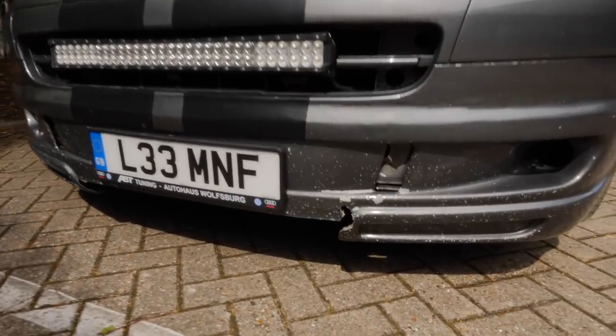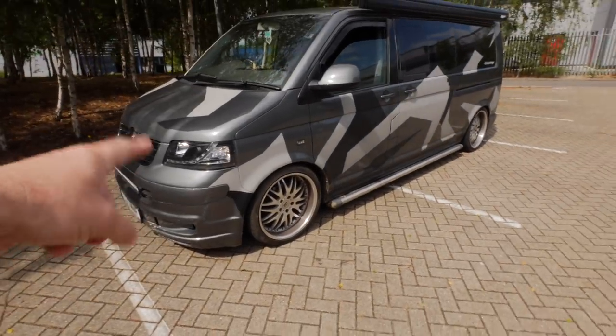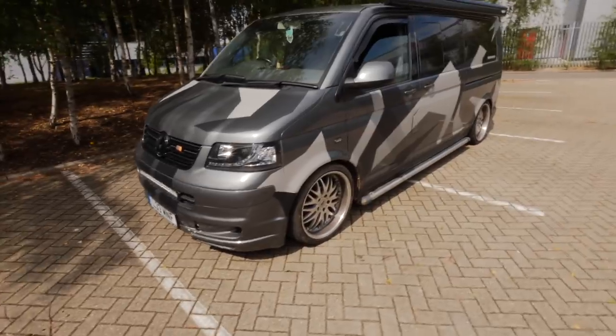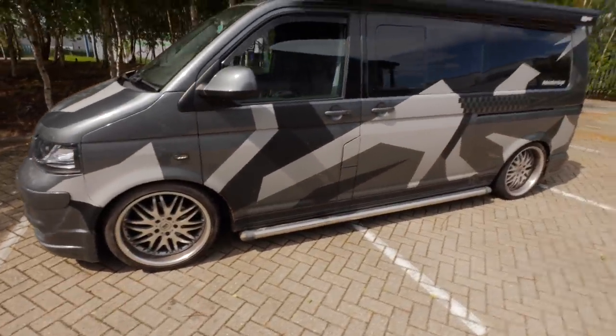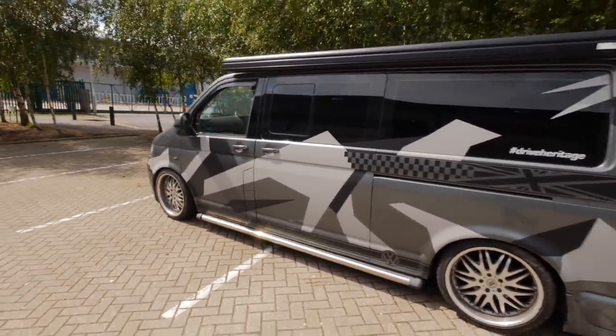It wasn't a cheap repair but doing it myself saved quite a bit of money - that was one of the first major issues. The tow man also managed to smash up my front skirt which I've not got around to fixing yet. A year after that, on a trip to Cornwall, the engine started overheating and boiling the water. After limping through the holiday topping the water up, it turned out the water was being pressurised - the head had warped. I also had the van mapped and I don't know whether it warped because of the remap, but I'd still map it again because it made such a difference. Apart from the engine, it's been your usual wear and tear - brake pads, a few bushes here and there.